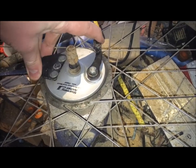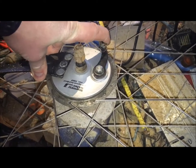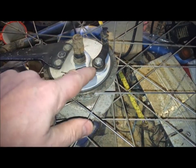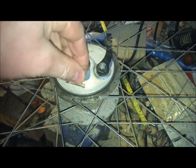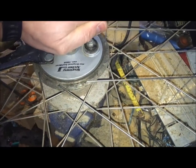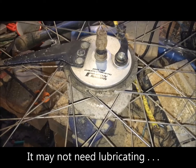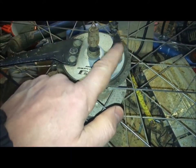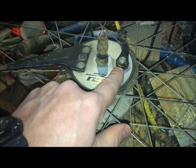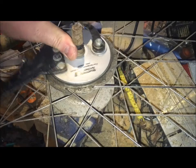What's happened is that this arm here, which actuates the shoes inside, has had its travel become longer and longer over the time period. There's a little cam inside which twists around, and the further the arm goes, the more prone it is to jamming when it's not lubricated properly. I used to take this apart every two or three years just to grease the cam — the only maintenance I've ever done — but recently that's become more frequent, and for the last couple of years I've had to take it apart once a year.